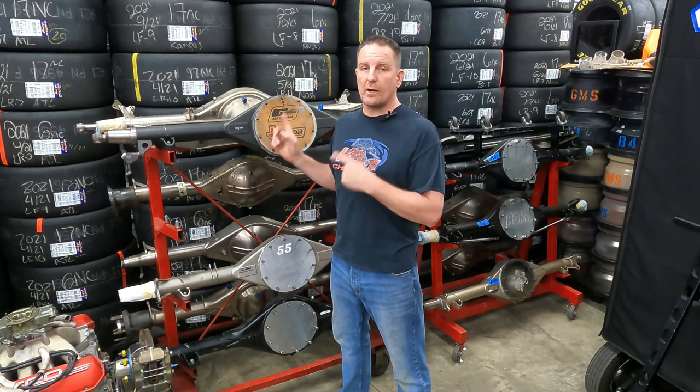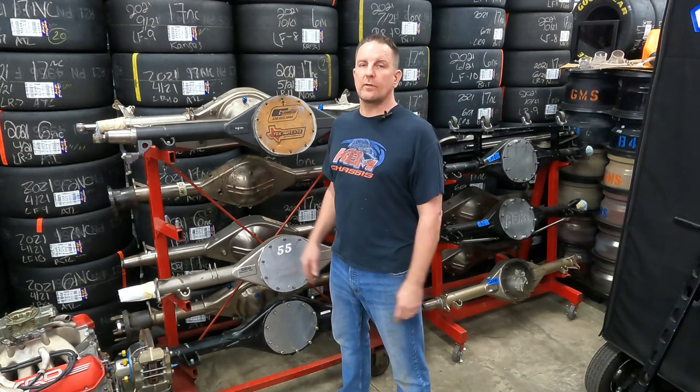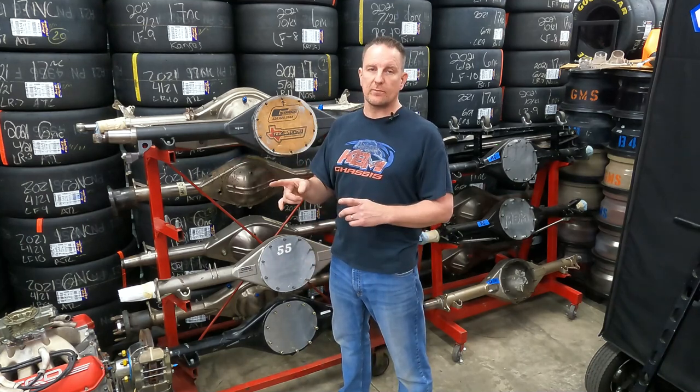Today, I'm going to be talking about a bunch of different rears, and they are not the ones you're thinking of. We're going to go over the differences in housings, how to measure their overall width, how to read all of the dimensions either engraved or written on the inside of the housing, how to measure for axles, because believe it or not, the right axle is different than the left. We're going to go over all of that, and I've already picked out a housing for the Supra.